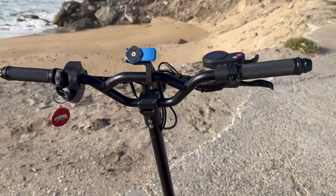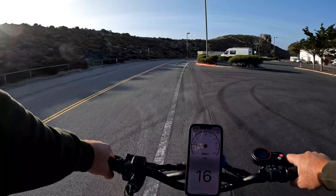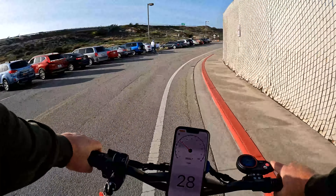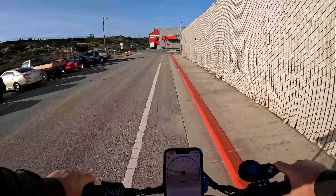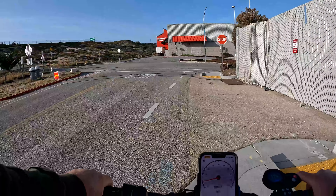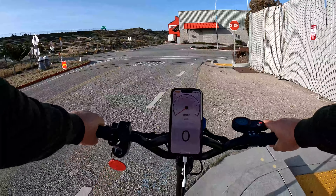It's rated up to 34 miles per hour. In the settings on P8, you can limit the power output from 1% up to 100%. For this test, I do have it on 100% power. Speed mode one shows 16 on the app and 17 on the scooter. Speed mode two is 26. Speed mode three is 30 miles an hour — that is the fastest scooter in this class. And that feels solid too; there is no speed wobble. It's a very solid and stable feeling scooter.